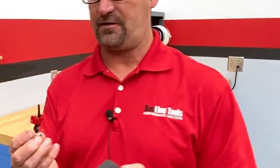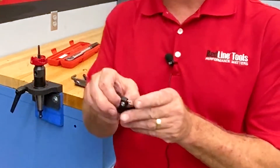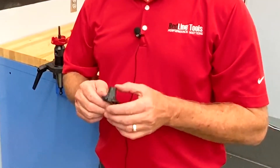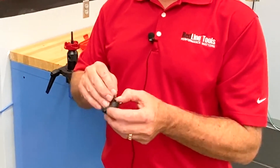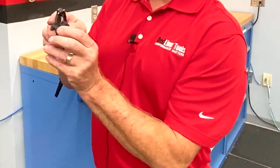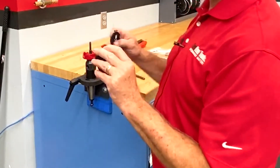Once the orientation is complete, you will put the open end of the spring into the pin on the blade. You can repeat that procedure with all four blades. Once you have all four blades ready to go back together with the hub, take your spring retaining clip and place it on top with the hooks going upwards. We can now hook each spring onto the clip and into the receivers on the hub.